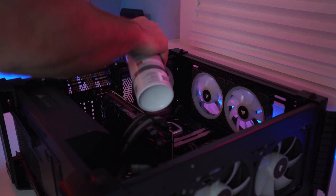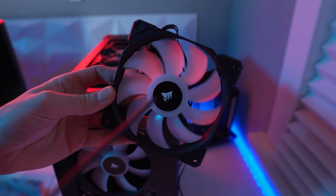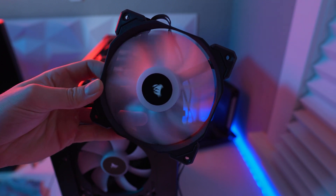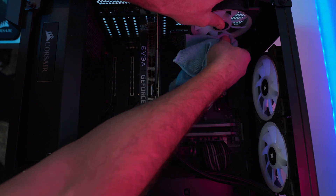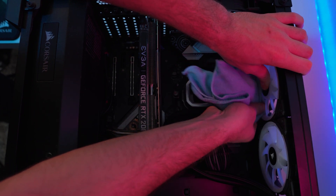Don't be scared — it's not going to hurt anything really, but try to prevent that spray if you can. Now that we've gotten our fan filters removed and cleaned, we can clean the fans themselves. Remove the dust buildup on your case fans with the can of compressed air. You can also use your finger to hold the fan to keep it from spinning, then spray one spot. You can use a little isopropyl alcohol and cotton swabs to clean the fine edges of the blades — but in this video I just used my microfiber cloth and went around each blade.